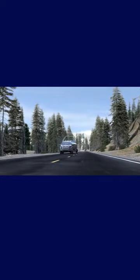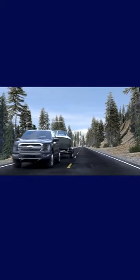In a traffic-free environment at approximately 20 to 25 miles per hour, tow the trailer on a dry, level surface and squeeze the manual control lever. A gain setting of 6.0 is a good starting point for heavier loads. If the trailer wheels lock up, indicated by squealing tires, reduce the gain setting. If the trailer wheels turn freely, increase the gain setting.